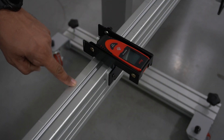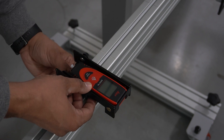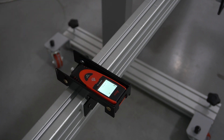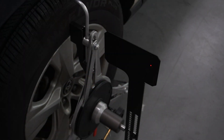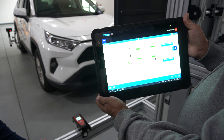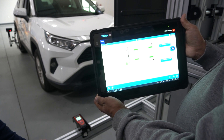Next, turn on both the crossbar laser measures to fine-adjust the calibration frame so the vehicle spacing is equal. This will help confirm the frame is square to the vehicle. Project the crossbar laser measures to the center of the leveling plates at the wheel clamps. Using the interactive IDC5 software, confirm both laser measures' distance to the vehicle is the same.